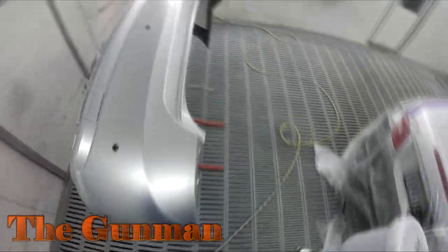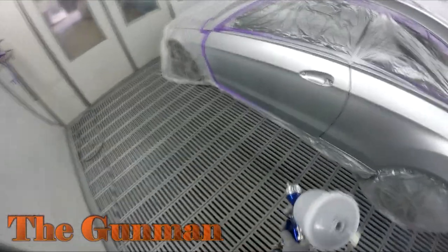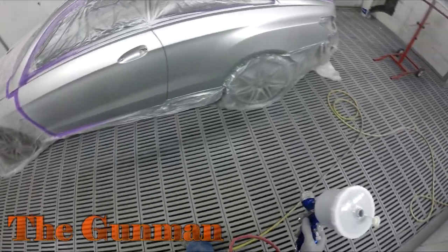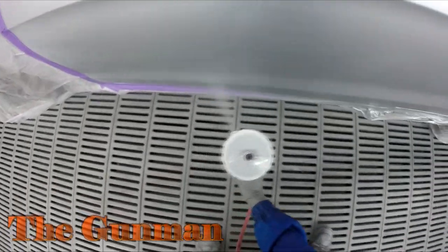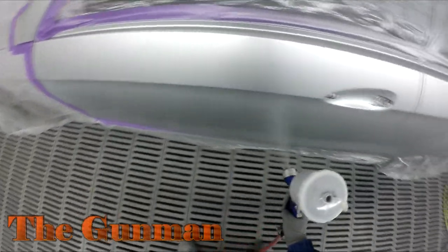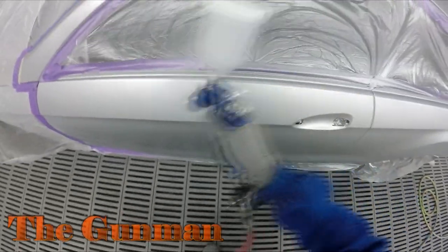Even little things like: is your compressor ready to be put through its paces with water-based paint? Because if you're using air blowers in a shop like this with two spray booths, two guys trying to use all that air, plus panel beaters running off the same compressor — you really need a screw compressor. We do have one now, and it's been one of the biggest upgrades in this workshop.